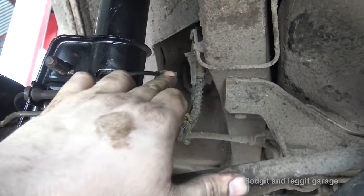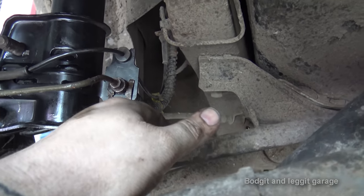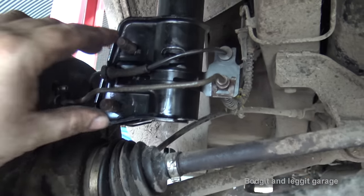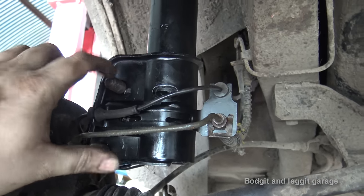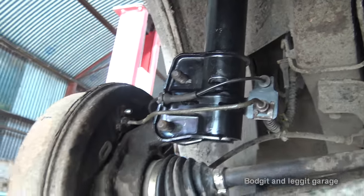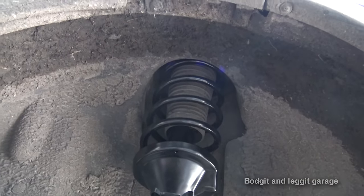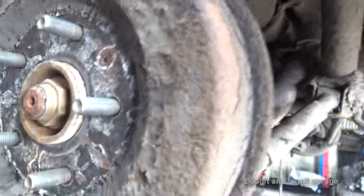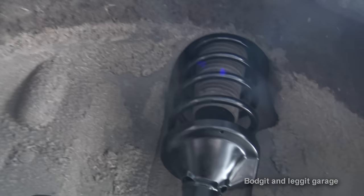But obviously we've got the ABS sensor on the right way. I've just taken off the brake line clamp. All I've got left to do is put on these two bolts, and I'm gonna do them to a heavy grunt. Anyone that watches my channel should know what that means. Then all we gotta do is tighten the ones inside and put all the trim back, and then we are good to go. New shocks, springs, and shock tops on.